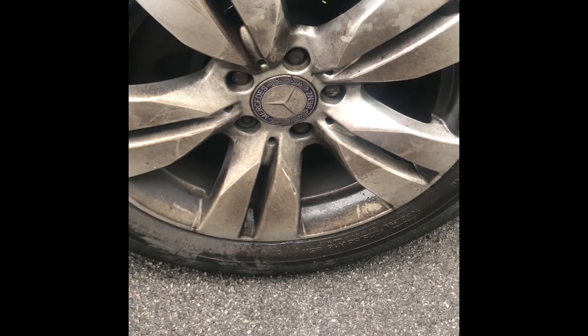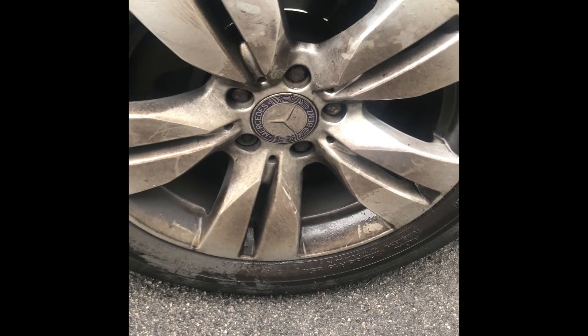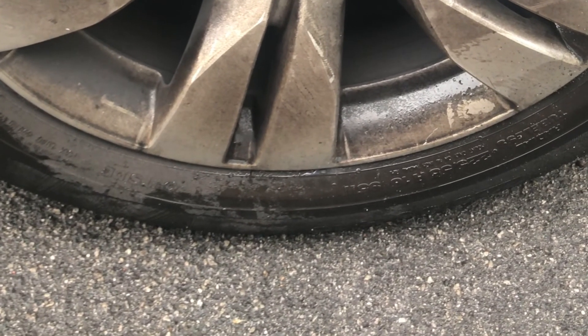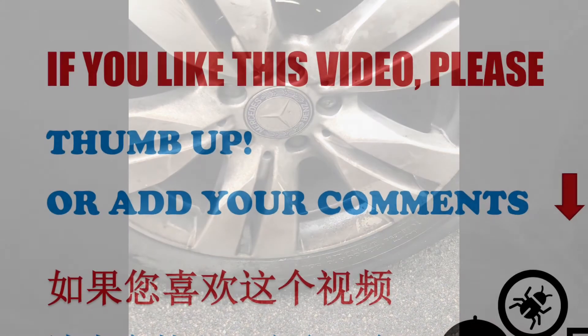Right now I need to drive for about five miles, or six to seven kilometers, to allow the sealant to go all the way through the tire inside to fill the puncture. This is very important — because I already know the puncture is underneath here, when you do the repair, try to make sure the damage is on the bottom of the wheel.